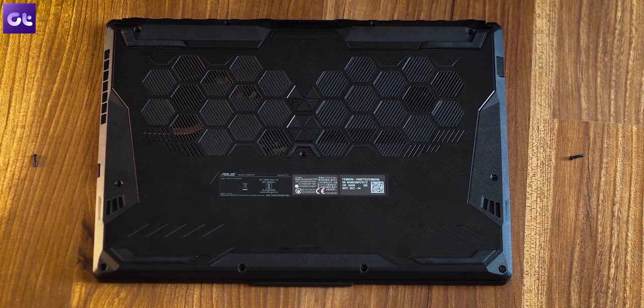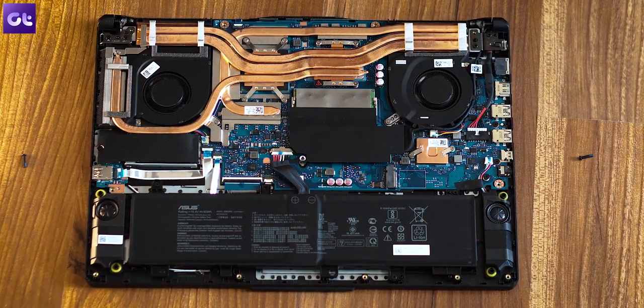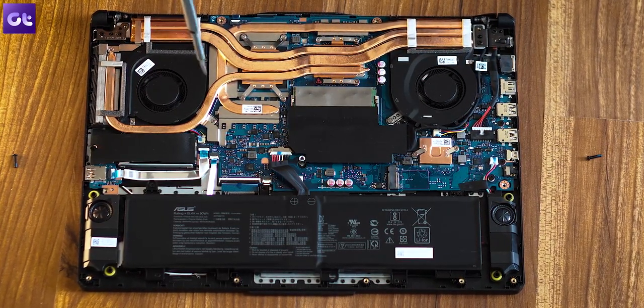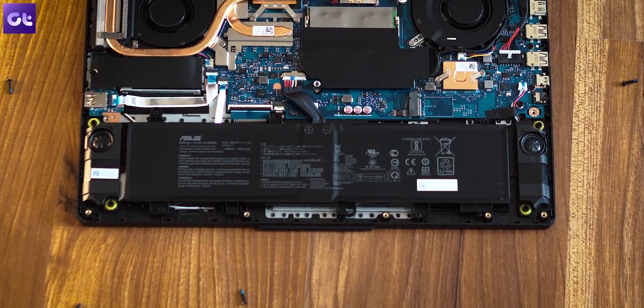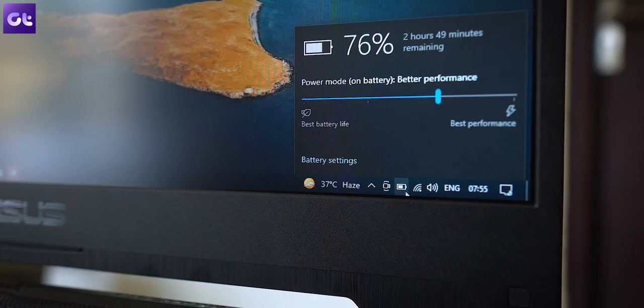Taking a deeper look inside the thermal design, I discovered what I think is the biggest factor I love about this laptop — the upgradability. Opening the machine is super easy and everything is well-organized. You get user-upgradable SO-DIMM RAM slots and an additional PCIe 3 M.2 slot for adding storage. For cooling you get two fans and a total of four heat pipes that are very efficient. Below all this is a massive 90Wh battery which, set to a balanced profile, can easily last about eight hours — pretty impressive for a gaming laptop.